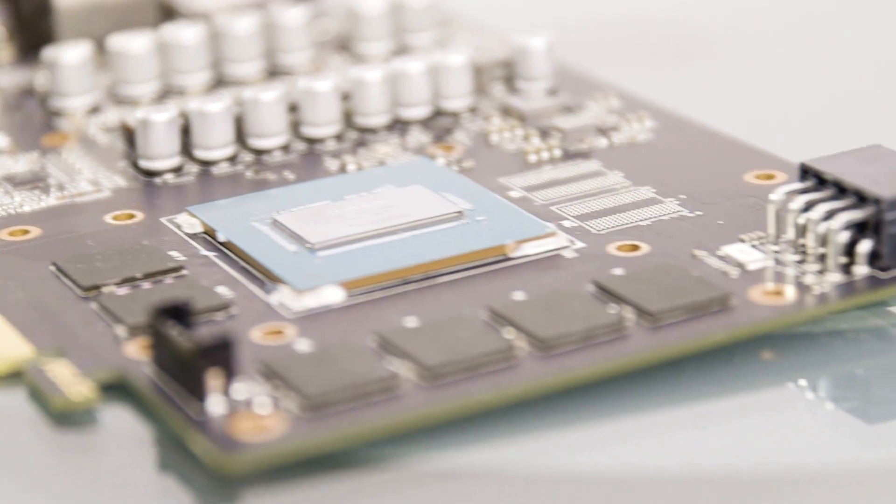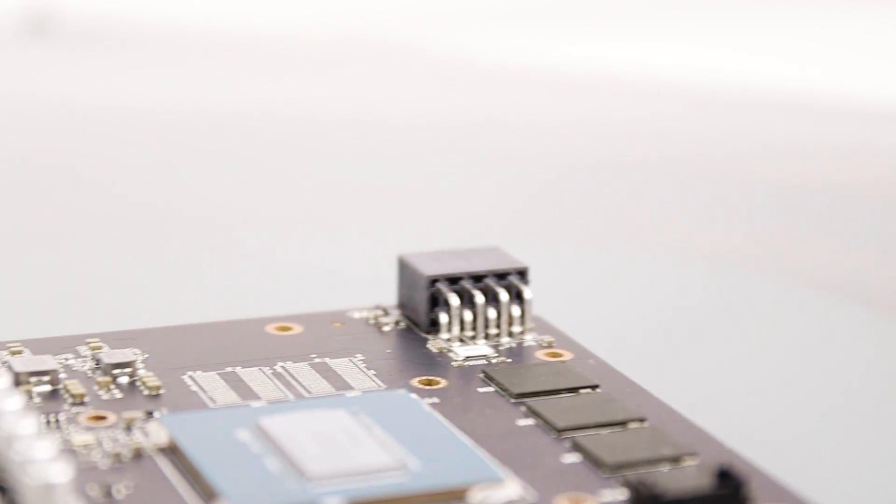The new GTX 1660 Ti is built with a brand new TU116 Turing GPU at its heart. This isn't just a stripped-back version of the chip that's been chucked in the RTX 2060 — this is a new beast entirely. It's still sporting the same Turing shaders as the RTX series cards, but this is a GPU aimed purely at traditional rendering, so gone are all the RT and Tensor cores for ray tracing and AI calculations respectively. In order to create a sub-$300 Turing GPU, Nvidia has sliced out the silicon which would have otherwise made it an RTX chip.